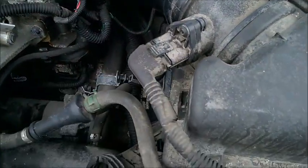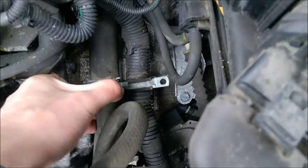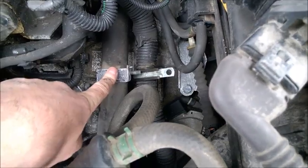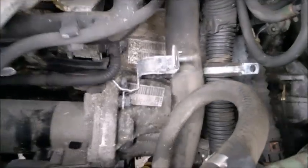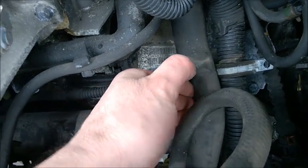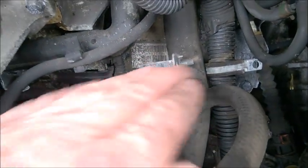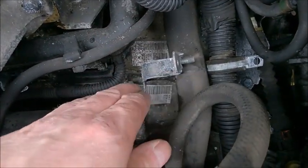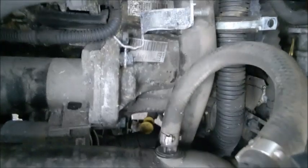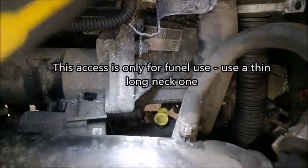Toss that bracket a little bit like this, slide the hose from the bracket itself. This is how it looks - you just open that clamp bracket a little bit and close the hose. The hose may even stay there if you keep the clamp a little bit closed. Sit it like this on a cold engine and then you can really reach the dipstick very, very easily.